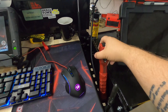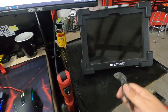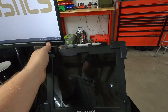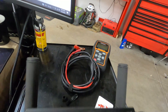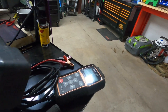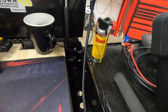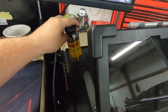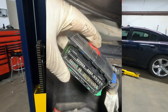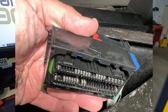Here I've just got a flashlight because you always need a flashlight. A magnet because I always drop stuff. Little pliers for fuse pulling. I've got my ATS 8-channel scope and then a battery tester — you always need a battery tester because a lot of issues are solved with a good battery or a fresh charge. And then I've got this IPA Deoxit — we actually have this on our website. It's excellent; it actually saved me on that charger right there. I'll post some pictures of what the PCM connector looked like before and after.